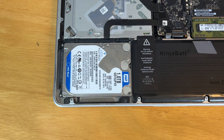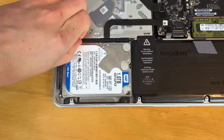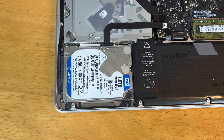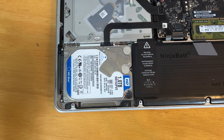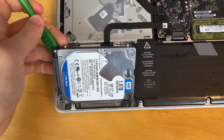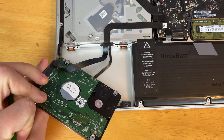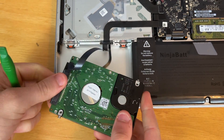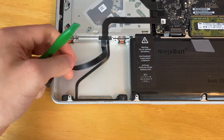Once we're at the hard drive, all you have to do is take out these two screws right here. As you can see, that little wall just pops out. Now if you can get it with your hand that's awesome, but I have a plastic prying tool. I'm just going to pry on the side of the hard drive and it comes out very very easily, and we can disconnect this cable here. Be careful not to tear it.